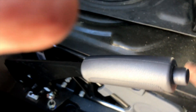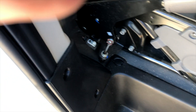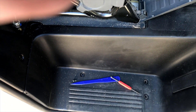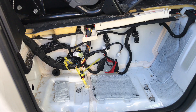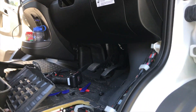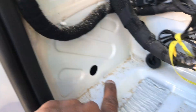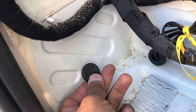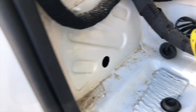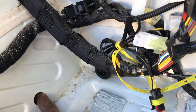Removing the side panel was quite easy — just three screws — and that gave access to the last screw holding down the door step trim. This is how it looks with everything taken out. Thankfully Fiat have very kindly made an opening here, covered with a piece of rubber, and there is another opening at the bottom covered by a similar plug — just pop it out and you should be able to run your cable through.